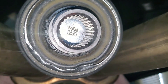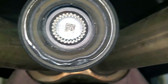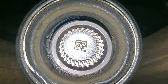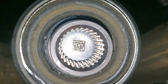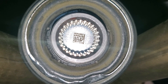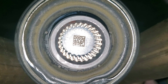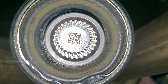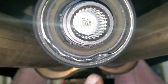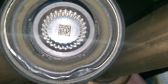I think I know why mine started clunking — somebody has been in here before me because I didn't do this damage to the drive shaft. When I looked inside there was virtually no adhesive whatsoever — just a slight film. I'm surprised it held as long as it did because you're supposed to have about 10 millimeters wide by 5 millimeters thick of adhesive so it self-seals the inner portion and cures without oxygen. Anyway, it's all primered up and ready for reassembly.